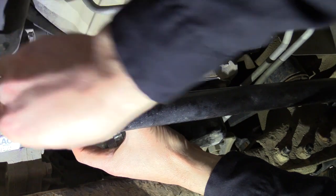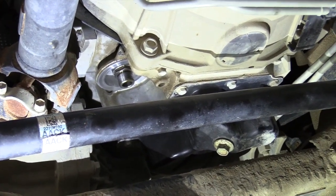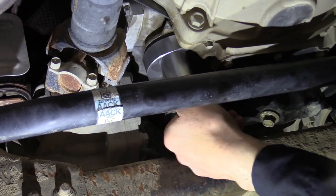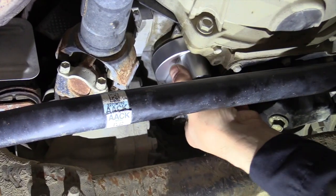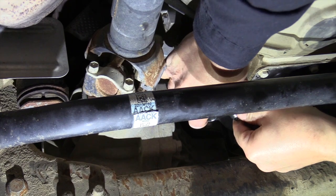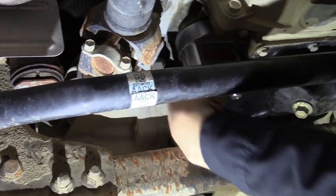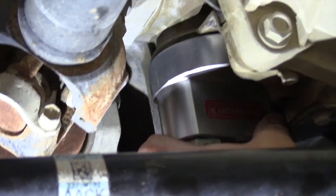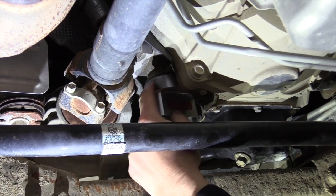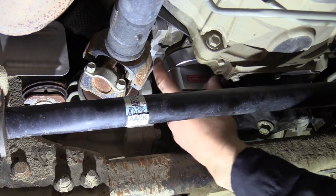You can get the one from AMSOIL if you want, but for the way we're going here I just can't get the angles I want. So we'll use the Hamburger's one — I've got that greased up. I'll put some grease on that O-ring and pop that up in there. Get it as tight as you can by hand, and if you've got a crescent wrench you might be able to fit it on. I've got an inch and a half wrench to finish snugging that up. You don't want it overly tight but you don't want it loose where it's going to leak. I've had guys before that put on AMSOIL ones and actually snapped the filter post, so you can't get too crazy. It needs to be tight, but not so tight that you do damage to the O-ring or to that filter post.